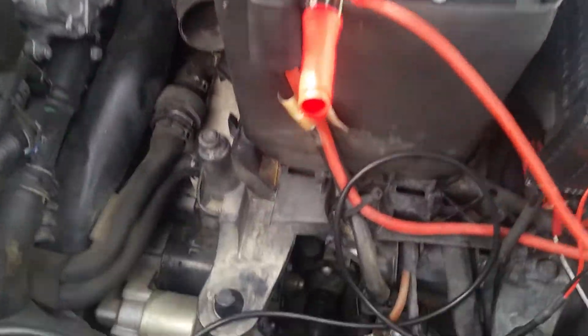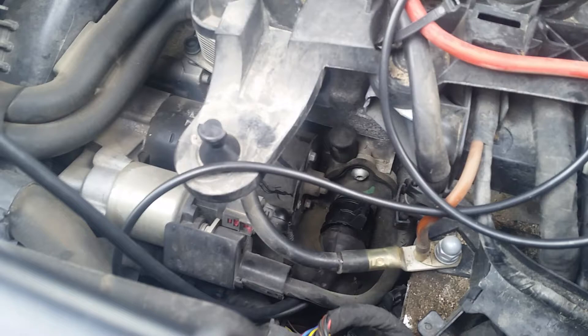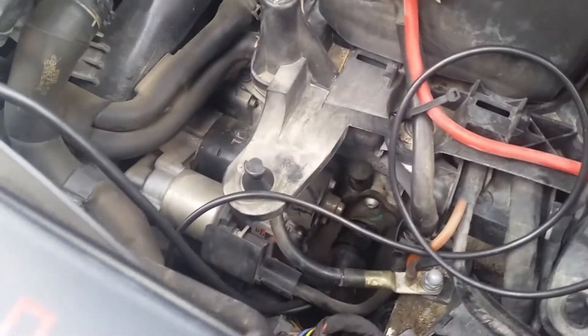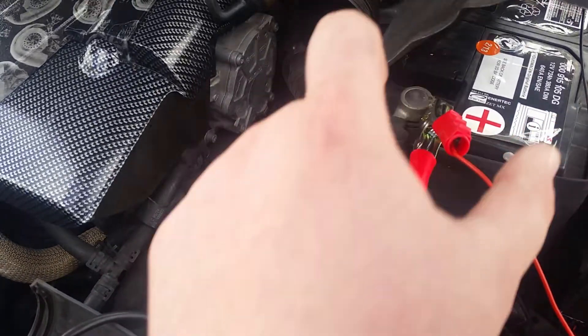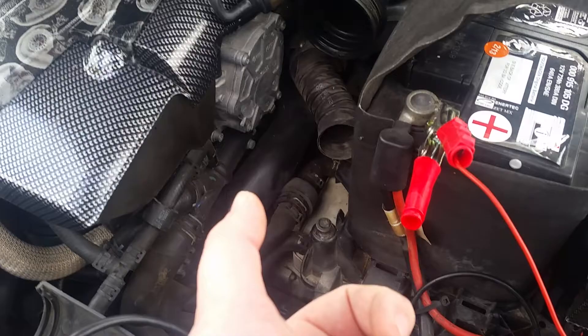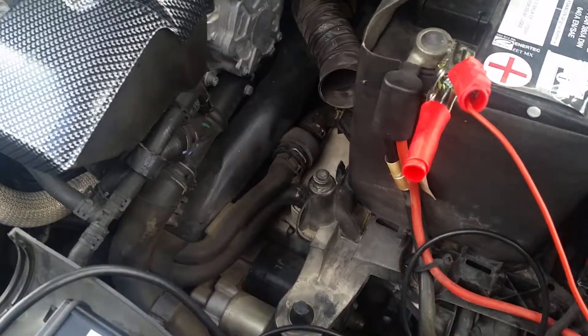Once that's out of the way, you can see the battery down there. Directly below the battery there is a cable. There's a tab on top pointing at roughly the two o'clock position. You don't push in and you don't pull — you take the tab and rotate it counterclockwise to about the ten o'clock position. You'll feel it get loose, then pull that connector out of the way.